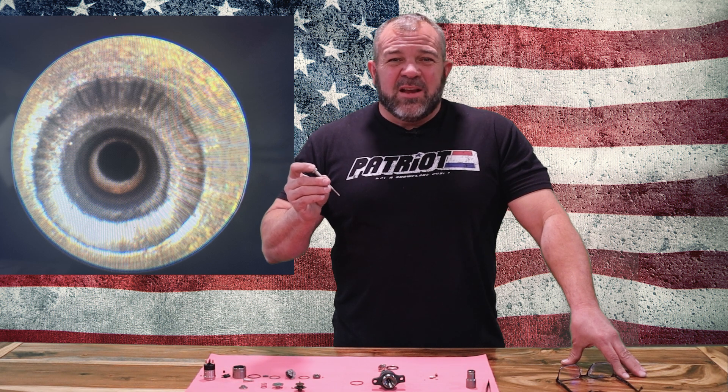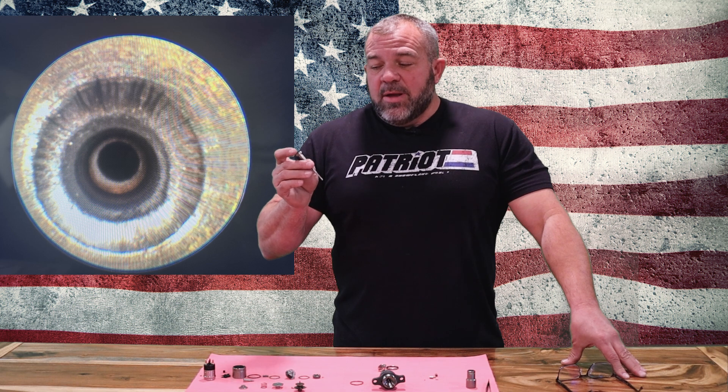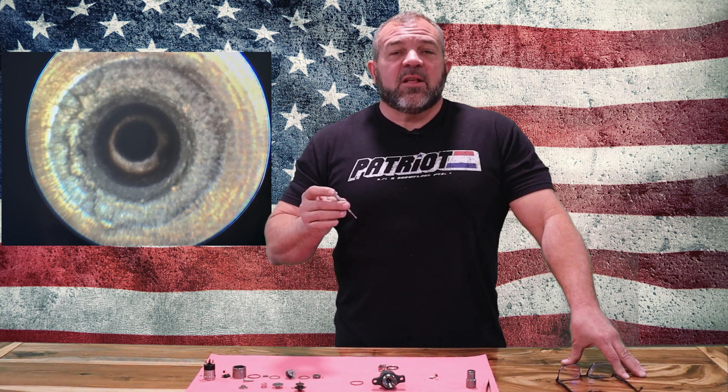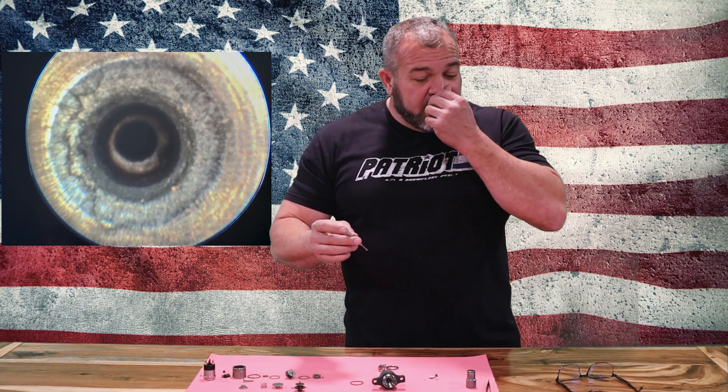It's got to be soft because when they machine these things in microns to get the clearancing right, they need to be able to cut them very accurately and very quickly. So if they gave you a material that was any harder than that, they wouldn't be able to give you those kinds of tight clearances.